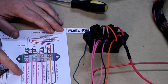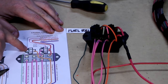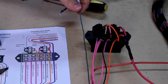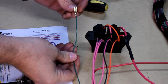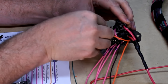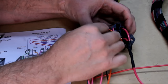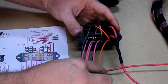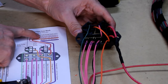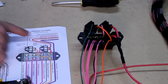Let's get this green wire. Here's my fuel pump relay - this is coming from the PCM. It basically provides power to the relay to tell it to turn the fuel pump on. It needs to go into the top circuit up here. Here's my green - let me get it trimmed up and a connector on it. I got the green connector on and it needs to go into the top circuit, actually flipped over. There it did. I've got one last wire and then I'm done - it's the pink wire going to a keyed source.